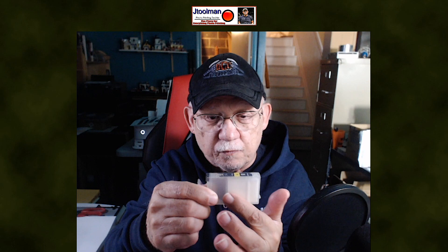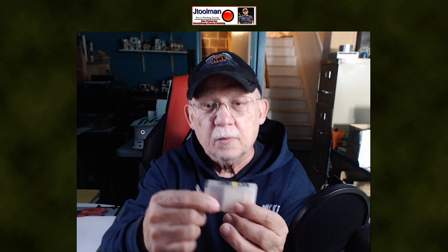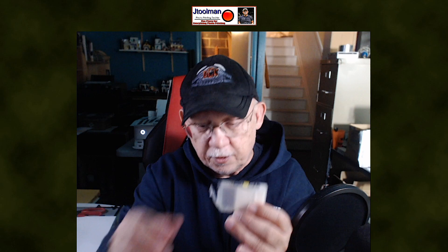So let's go to our actual cartridge we're trying to refill. This one is already flushed. What we need to do is put a clip on here, remove our plug, reset the chip, and add ink. As you add ink you will see it permeate the sponge — it's going to begin to flow across the sponge. As you transport ink from the liquid side to the sponge side, the levels will begin to drop. Wait a little while, let it adjust itself, then add more ink. You want to go a little higher — maybe almost touching the plug. That's about eighty percent capacity.